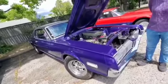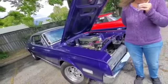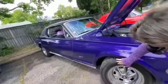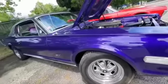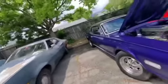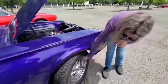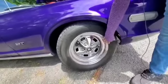What updates did you do to the outside? Like the tires, or anything else? So the tire size originally was 215R70s, and they used to have like a red line around them — a thin area — and they called them red walls. The tire size I have now are 225/60R15s. And then the wheels are also an upgrade from the original style. The outer part used to be a knockoff, and then the inner part was always there. When they made the upgrade, they molded it all together — it's one solid piece.